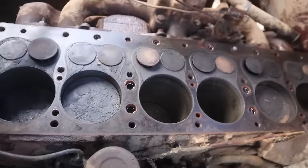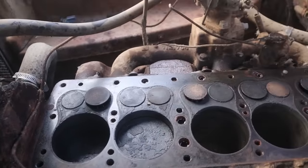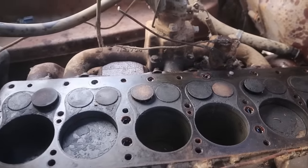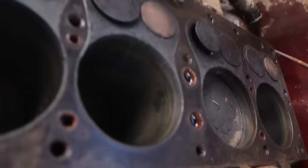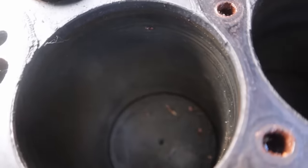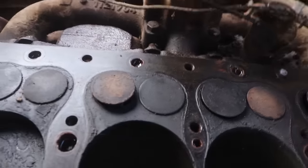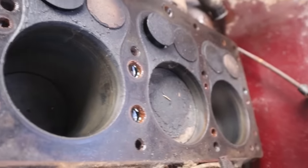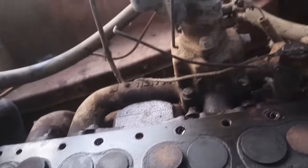Kind of fun to look inside these old things and see how time has treated them, because most of them were crushed before I was born. But we definitely have a savable one here. You can see there's some light surface rust on the cylinders, but they're really smooth, no gouges. Little bit of footprint where the rings were sitting, but nothing too serious. Actually, really, for what we are used to, that's a pretty decent engine.